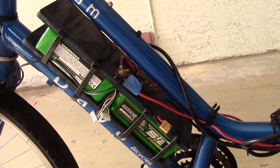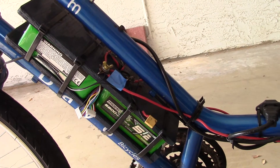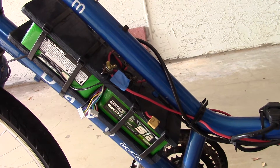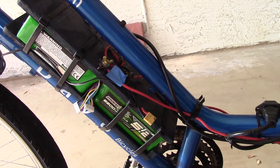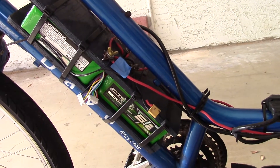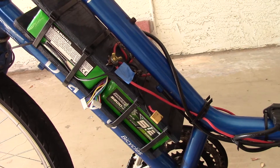I've put a thousand miles on these batteries, and I'm using them in a very limited range. I charge them to 4 volts per cell, I put about 12–13 miles on them, and they've never gone below 3.8 volts per cell. Very, very stable system. I'm using a constant voltage of 48 volts to charge them.